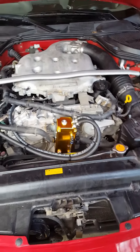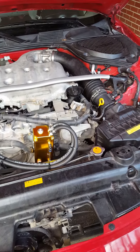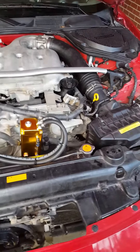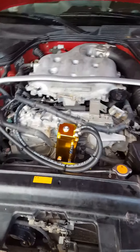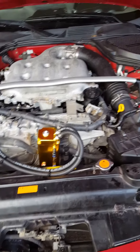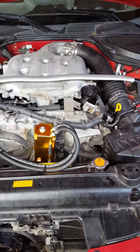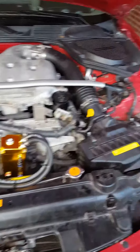I just want to make sure the intake is not getting any oil, because nitrous oxide and motor oil do not mix — you're asking to go kaboom. So I'll run this for a few weeks, make sure it's working properly, and then I'll go ahead and proceed with the nitrous oxide system.